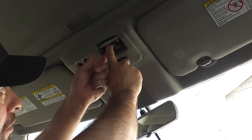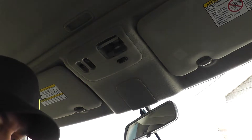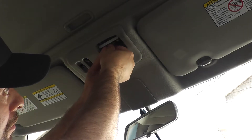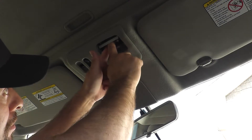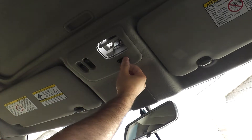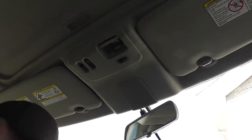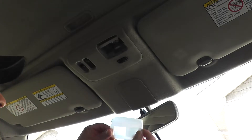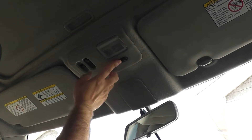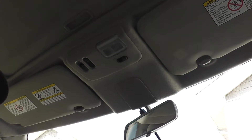It's a little bit hard to do, but there is the standard bulb. Grab the LED and do the opposite — slide it in sideways and twist to lock it on. Turn it on to make sure it works — you can see it working. Put the cover back on, it only goes one way, and push it back on. That's the front done.